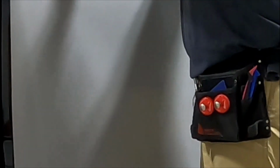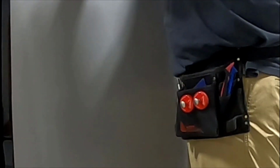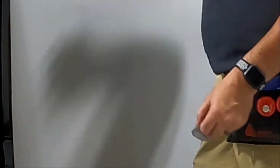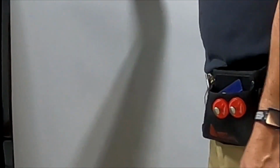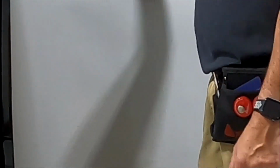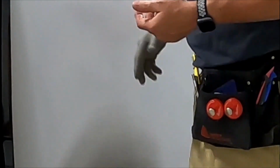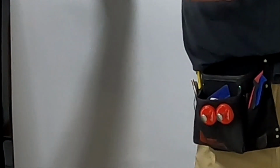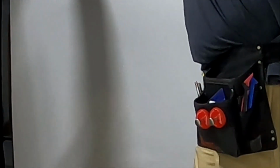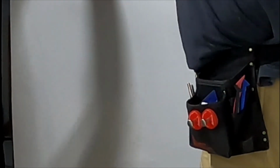Now when you do your relief cuts, you want to try to not stop in a straight line. Your vinyl, when you go to stretch it and put stress on it, if you have a straight cut, it will split and more than likely go into the panel where you obviously don't want a cut. But yeah, so you'll take some of the tension out of the corner.